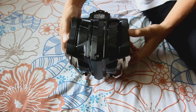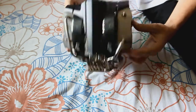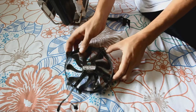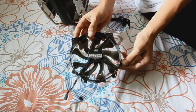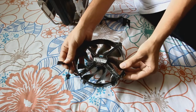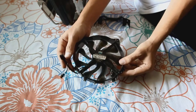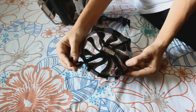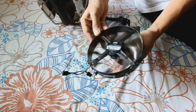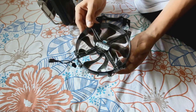What I'm going to do now is show you a closer look at the heat sink. I'm going to remove these two fans and show you the tower itself. So, this is the Cooler Master Jet Flow PWM fan, which spins at 1600 RPM at the max from the lower RPM of 600. You could control that using the duty mode in the BIOS as per your requirement, but to be honest, these fans are not that good when spun at low RPMs.